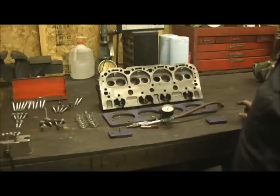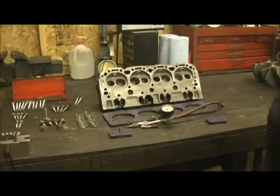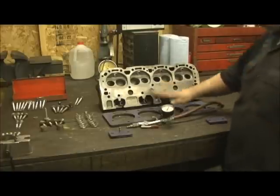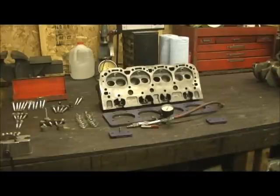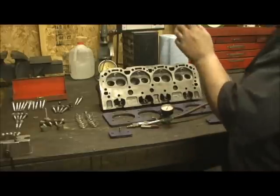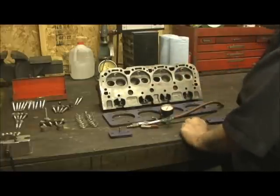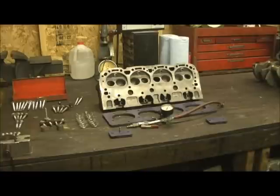The reason I got this ain't for the purpose of pressure testing, per se. It's mainly for the purpose of, after I weld them, to pump the head. This is what you have to have to pump it, and like I said, it makes all the difference in the world. Every head that I do a serious port job on, I either carry it to a shop and pressure test it, or I like to do it myself. But anyway, it's pretty straightforward.